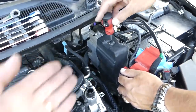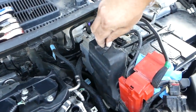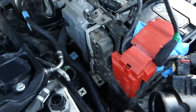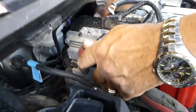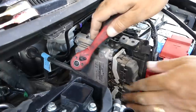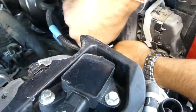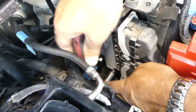You can see we need to remove that pipe so we can reach the ECU here. For the intake, you can just remove the small section — it works as well. Remove that clip by unscrewing the middle part, pull it up, then remove that plastic piece going down there. Now with a 10 millimeter socket, we need to remove four nuts: two on top right here, and two on the bottom that are hard to reach, and one on the front side towards the wires.